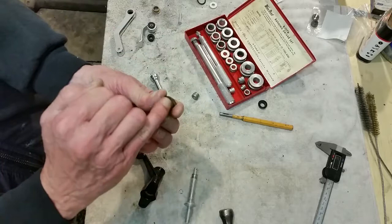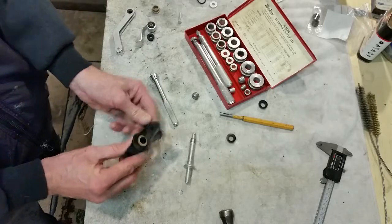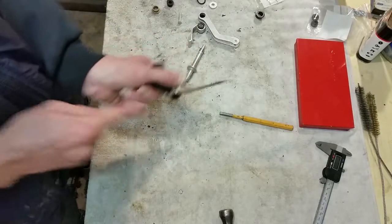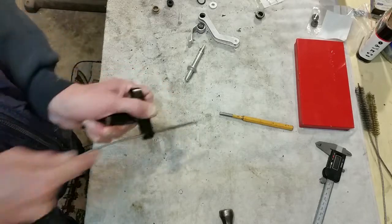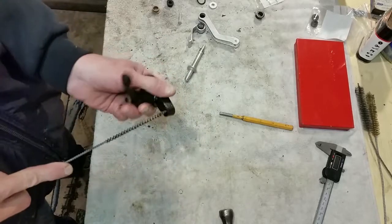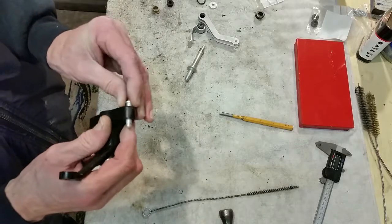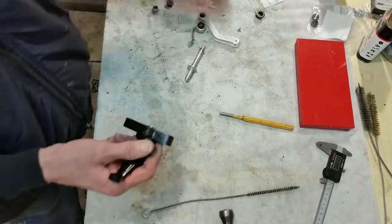Probably won't be able to put the old pin back in, because sometimes you furl that edge driving them out. Anyway, that's how you put your new bushings in. A good little trick I always use: sometimes when I paint these I get a little paint inside, so I run a wire brush in and out of those a little bit to clean them up — all the way through and back a few times. Also, when you have the pins cad-plated, it adds a little thickness to the pins, but that one fits in and moves quite nicely. I think we're good on the pins.